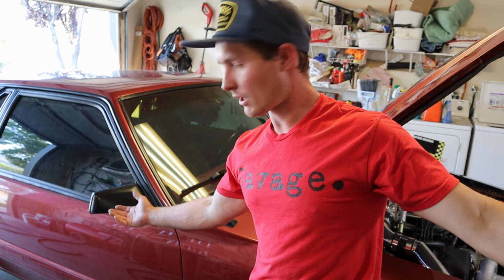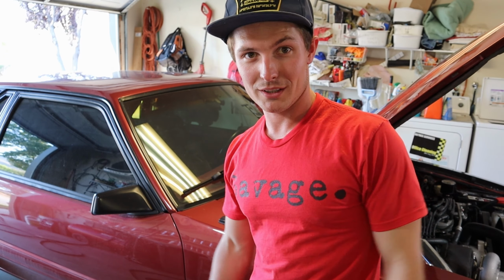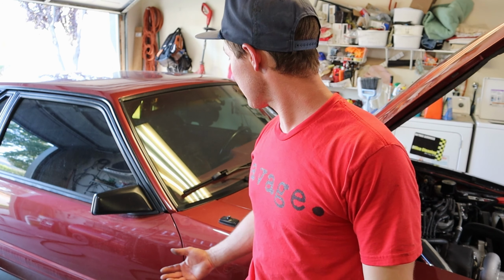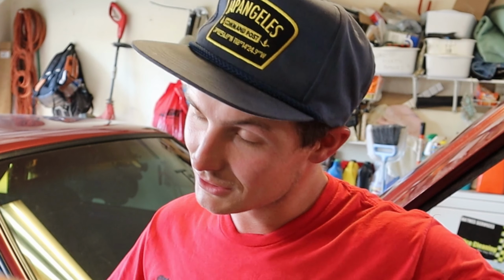All right, so now that we got our distilled water and our flush, start the car up, get it heated up, get that new stuff flowing through its veins, and, my brain went blank. Oh, and then we can drain it out again, which I don't know if I'm gonna do tonight, but let's just get it up to temp.